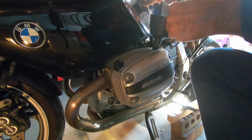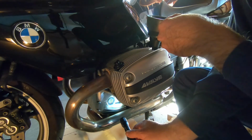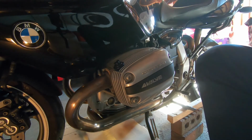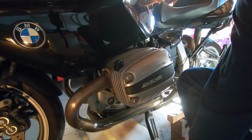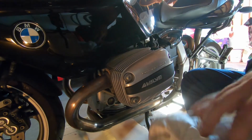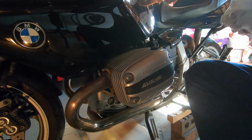And then I was checking for the oil, and I just looked in the crankcase. It was a little different design than this BMW. Here, if we put the oil in, it goes over all the lifters and stuff like that in the head. But the other bike I had, it just went right into the crankcase, and I didn't know there was that little window to take a look at the oil level. So just to be extra safe, I'll just throw another liter of oil in there. Okay, great. And then I still don't know how much oil I have. Well, just to be safe, I'll put some more in. So I had way too much oil in my first motorcycle, and it started blowing blue smoke out the pipes.